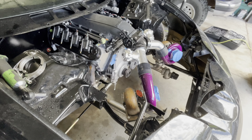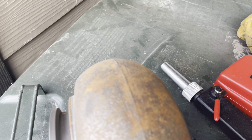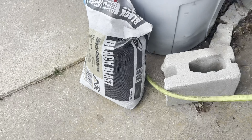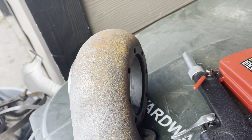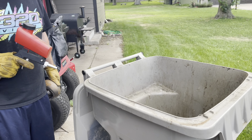I'm going to take you guys along for the ride — I've never done it but we're going to see how it goes. Got the turbine housings off and I bought this little Harbor Freight blasting gun, got it for like 12 bucks. Cheapest blast media I could find was at Menards, about nine bucks for the bag. I've kind of started on this already and this thing is cleaning up really fast and really well. Got the sugar mama coming out to record — probably going to get her all dirty. Here's my fancy blasting cabinet, works real well.